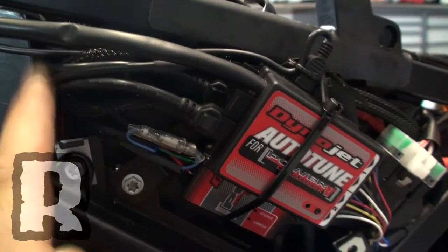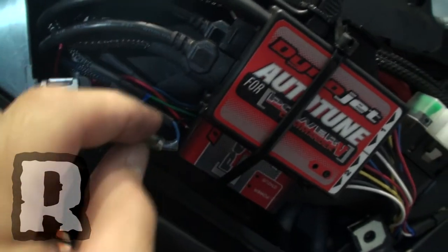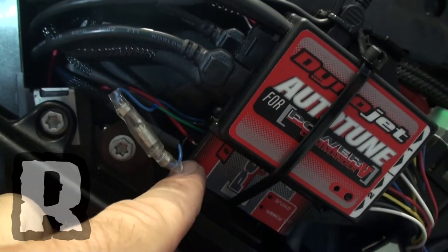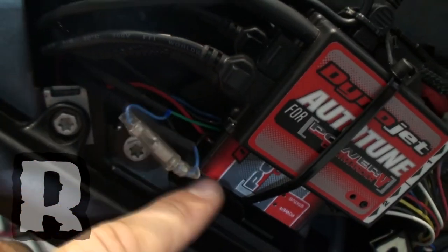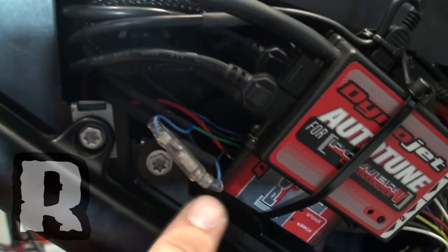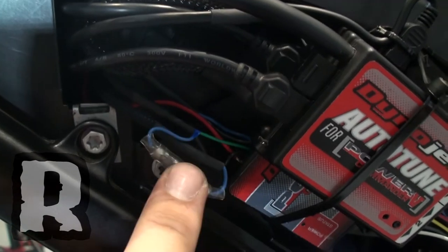The CAN cable runs in this little crevice here and then runs back out to join the Power Commander 5. For the quick shifter: we run one wire from the quick shifter lead into the Power Commander 5, and the second wire goes up to the handlebar switch. The other wire from that switch runs back and plugs into the other port where the quick shifter would have gone. So you've split the two wires out to the switch — one wire from the quick shifter lead, one wire from the switch lead, and the two leftover wires joined together. That makes the signal go through the switch so you can turn it on and off.